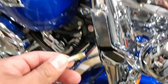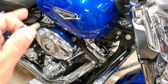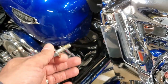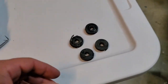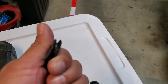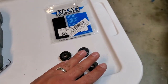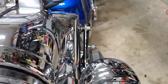I just removed the bottom one and it looks like it used to have some Loctite on it. I want to stay consistent with that, especially because this bike vibrates quite a bit. So I'll remove it, clean it up, put a little Loctite on it, and put it back with the same tightening approach. Looking at these old grommets — man, it's like somebody's dog got a hold of them. These things were beat to hell. On eBay it was about 20 bucks with free shipping, so let's see if the windshield goes on without issue.